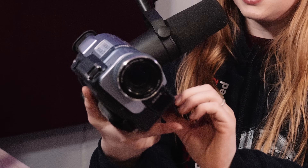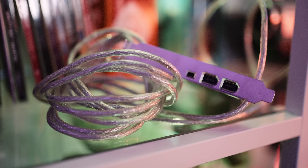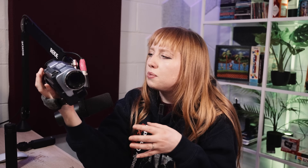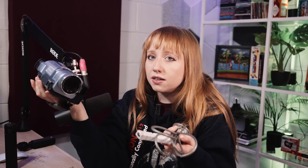There's actually a DV-in on this camcorder, and you can theoretically use the DV-in to transmit video from your computer back onto the tape. But it became more complicated when I realized that no modern editing software has that capability anymore — it's gone. I couldn't even find a way to upload a tape through FireWire in Premiere.